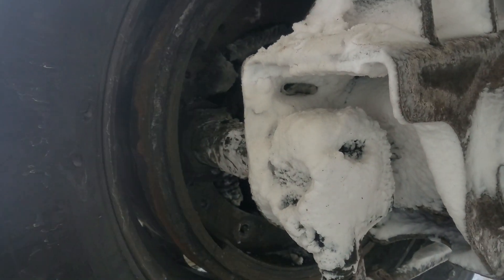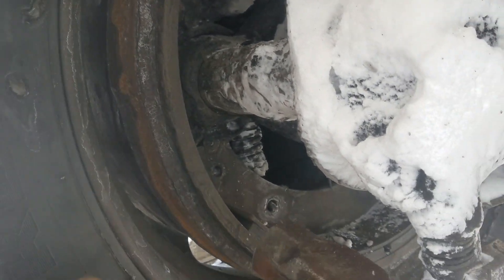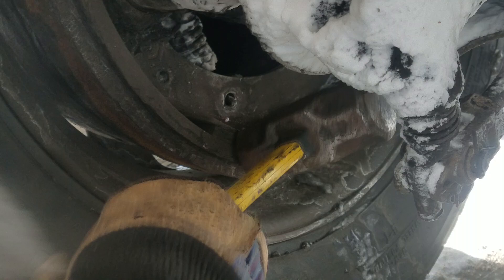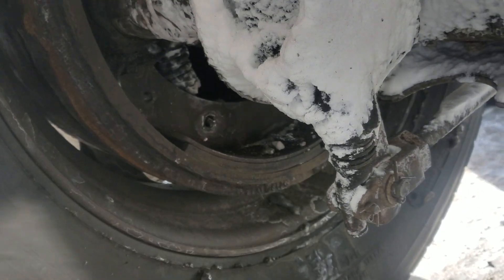Release the air, use the punch, use the big hammer — put it on the flat part of the brake on the shoe, the flat part if you can. If you only have a hammer, try to hit it right on this edge, right here on this edge of the brake shoe. That'll pop it loose.